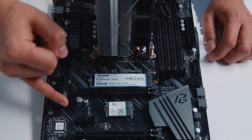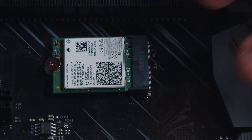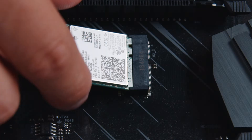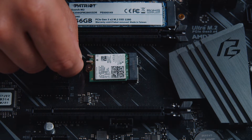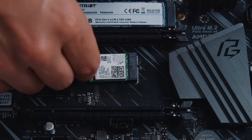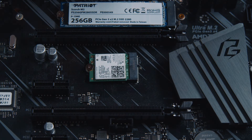We've done a video on removing the graphics card if you need it. Now, once you've located the M.2 card, you'll see there are two cables and one screw, and it's sitting inside a little slot. First, unscrew it, then you're able to lightly pull it out. If the cable is attached to the motherboard, it's easy to pop them off — grab one and pull it straight up. Don't pull it to the left or right, just gently pull up and it'll pop out very easily.